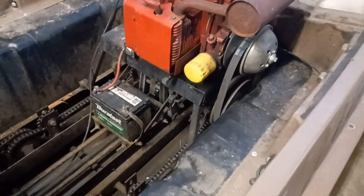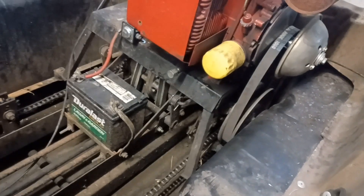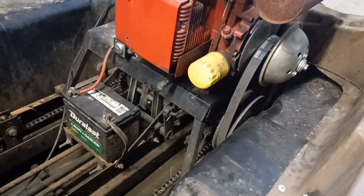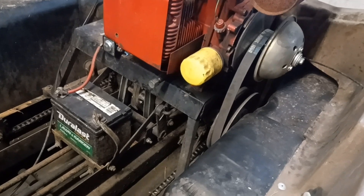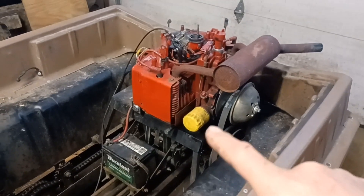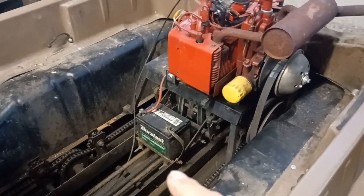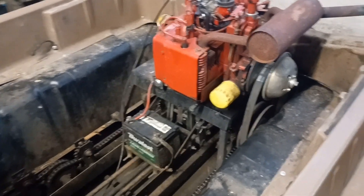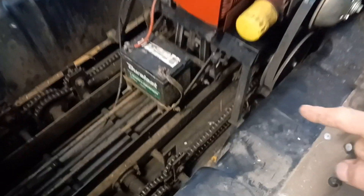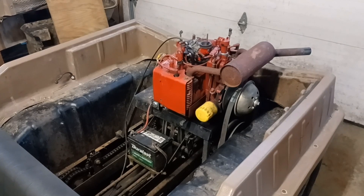Underneath the engine is the transmission, and the shifter rods run on both sides and they have to shift backwards together. There's apparently a little pin down in there that we're going to have to check and see if it's damaged or not. So we're going to have to pull this engine out or at least slide it forward to get to that transmission. We'll start by tearing the battery terminals off - you always want to disconnect the battery first - then check for any wires or lines, get the belt off, and unbolt from below.